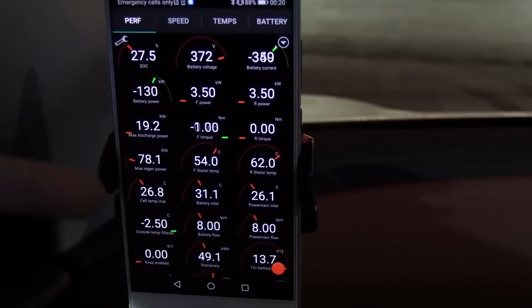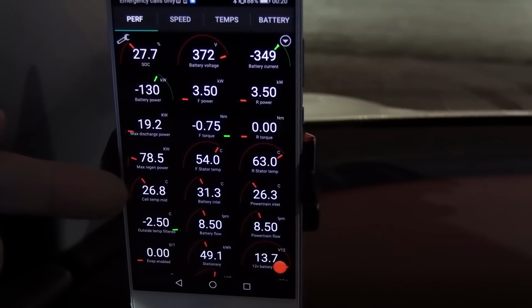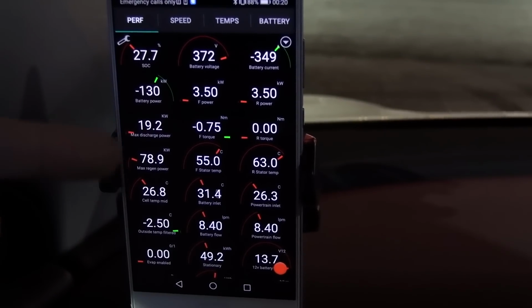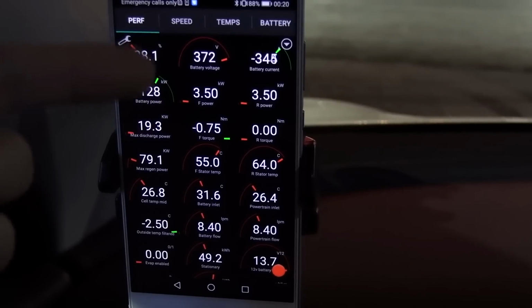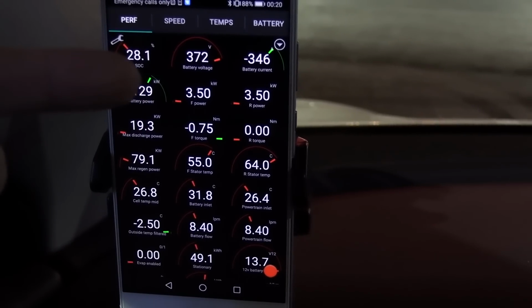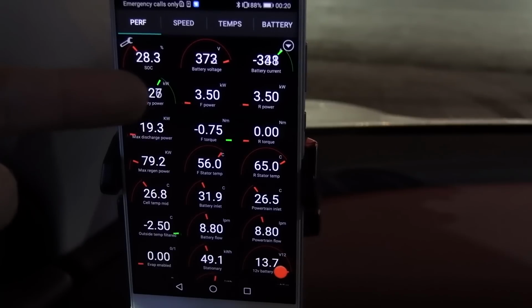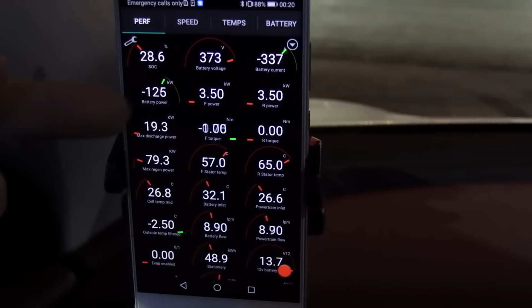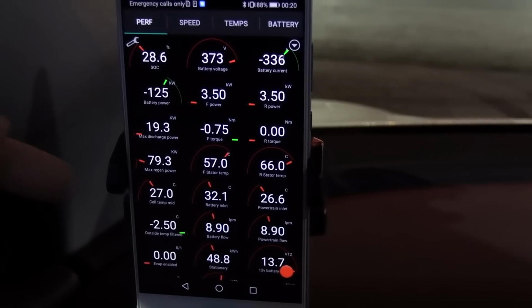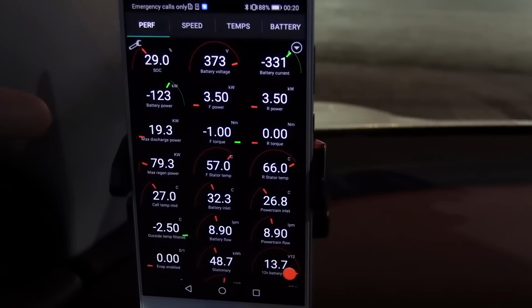It will run this until the battery is at around 40, 45, actually sometimes even 50 degrees. So there's not much you can do. This is controlled by the car. That's the way Tesla Model 3 works. So sometimes I kind of wish I could switch off these afterburners, because I only need to top up a little bit and I don't need to waste the 7 kilowatt on heating up the battery unnecessarily. But nothing you could do about it.